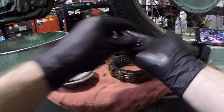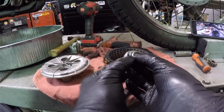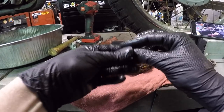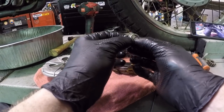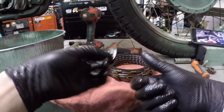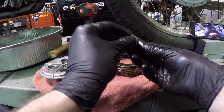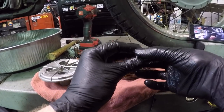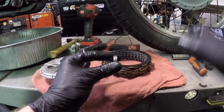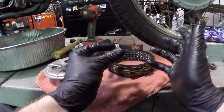These are spark plug washers off of GL 1800 spark plugs, BKRs. You can remove them by just grabbing them with a pair of pliers and twisting the spark plug off of them. And they're all the same size, and what I'll do is take them, get them bunched up like this, and go to a press and just press them one nice soft time so they're all pretty much the same.